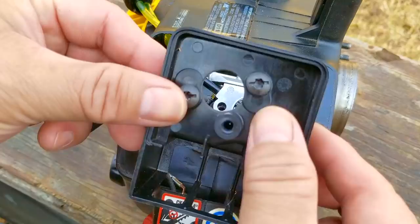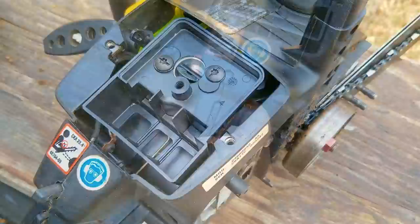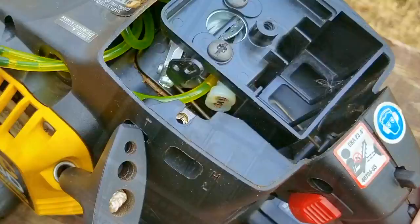If you don't see any fuel, then you might have a carb issue. Now that I know ours is good, I'll continue putting the saw back together. Once the filter base is back on, check to make sure that the throttle is working like it should and it's not getting tangled in the wires or the fuel lines, otherwise your saw might stay at full throttle the first time you squeeze it, which is quite dangerous.